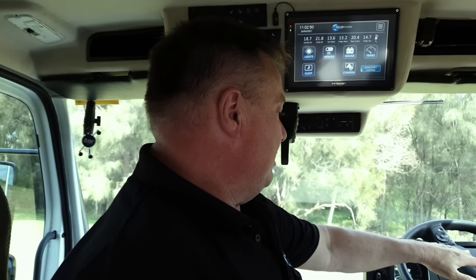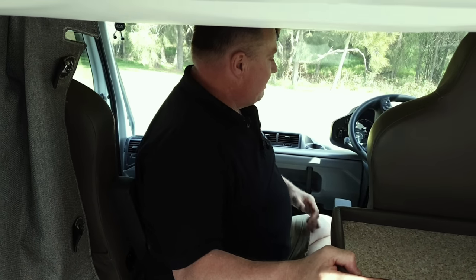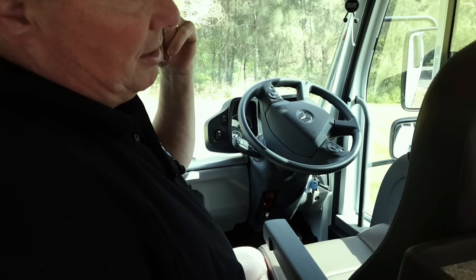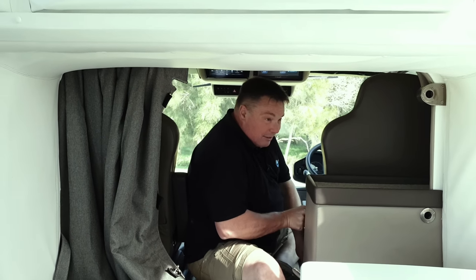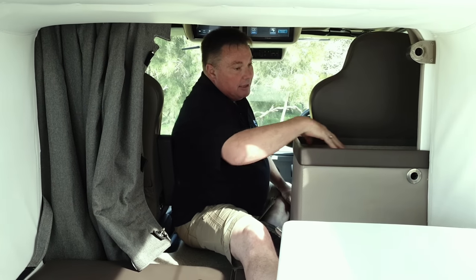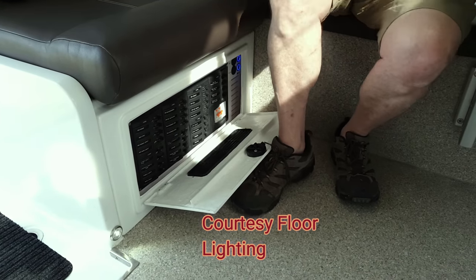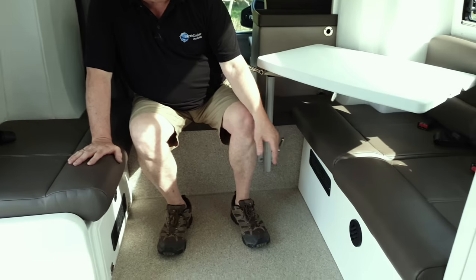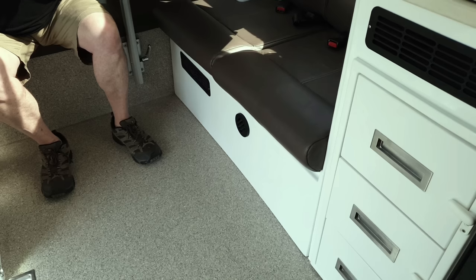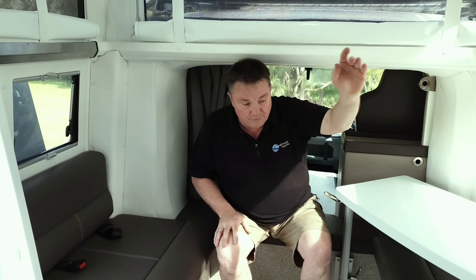This is the setup that allows you to put the steering wheel from left to right in 27 seconds, allowing customers to drive all around the world on the right side of the road. We've also put multiple switch panels down on the doors on both sides, so it's as if you're driving as master on either side. There are torches placed throughout the vehicle and a phone holder with charger. Under here we've got the electrical control box, 240 volt, main battery switches, and full digital control system. Underneath the seat, one side is storage, the other has the battery management system, solar regulators, and heating systems, with solar panels on the roof feeding down through to all the regulators.